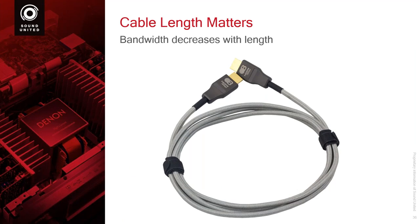The length of the cable matters. What is the maximum realistic length for a 2.1 cable? It all depends. We don't know because they're just starting to test those cables. I do know right now that if I look at 18 gigabits, after you get past about 18 feet, most passive copper HDMI cables struggle to support 18 gigabits. So length has a major impact on the bandwidth that can be supported. But if you have a good 2-meter or 3-meter high-quality 18-gigabit cable from a reputable company, there's a good chance that cable will support the bandwidth required to enjoy a 2.1 source. It just will not be certified.